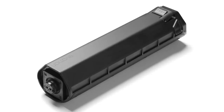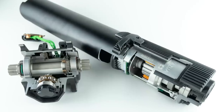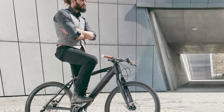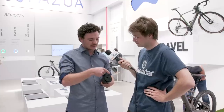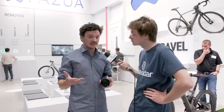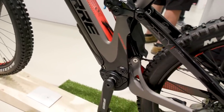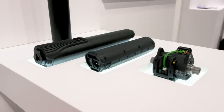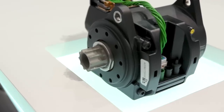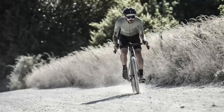With that system you don't feel any drag, and that's because of where the motor is located — not in the bottom bracket, so there is no drag when it's disengaged. By placing the motor in the down tube rather than the bottom bracket, we could incorporate a freewheel which disengages the motor from the bottom bracket. So whenever you go faster than 25 kilometers per hour, you are not pedaling against the resistance of the motor and all its planetary gears — just against the resistance of the bottom bracket, which is around 10 watts. It still feels natural, and the same applies when using the down tube cover — the unmotorized version has virtually no resistance.